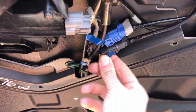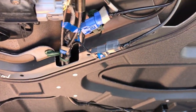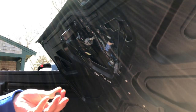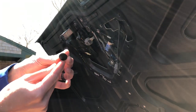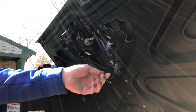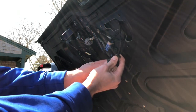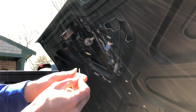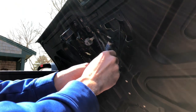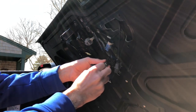You're going to reach up to the top here, push in, and this whole thing will just pull out. When you pull this plate off, you have these black plastic clips — just reach under with a flathead screwdriver or needle-nose pliers, give them a tug, and they'll pull out with a little effort. After getting this wire connector out, disconnect it by pushing the bottom piece and pulling it apart. This is the wire that goes up into the switch. Take a thin paper clip, unbend it, and stick it in to short out these two terminals.